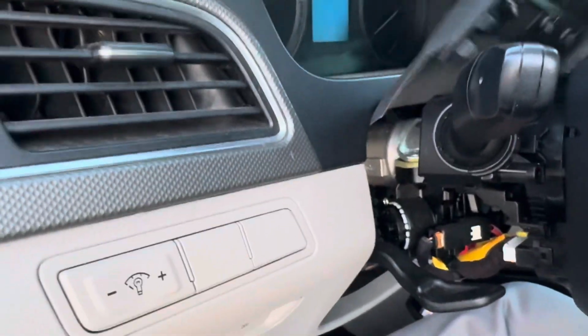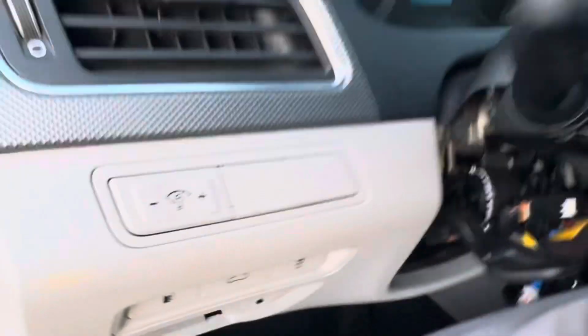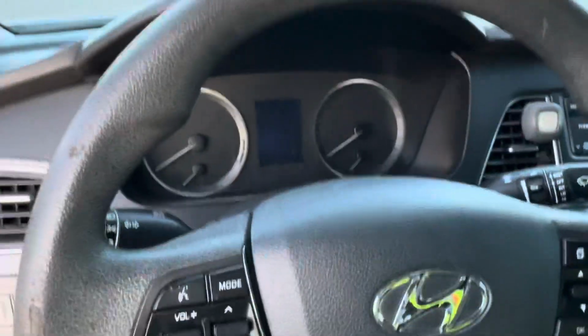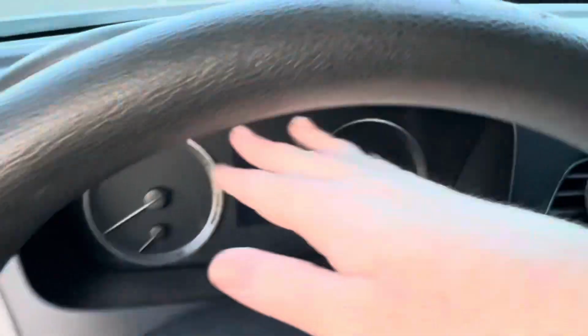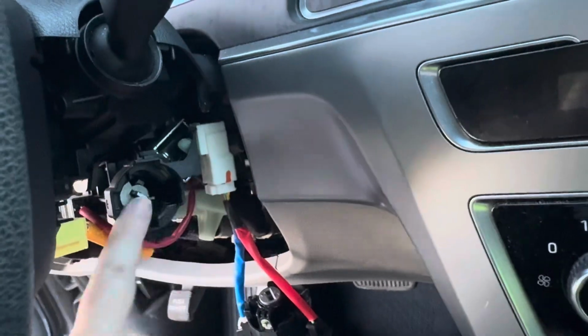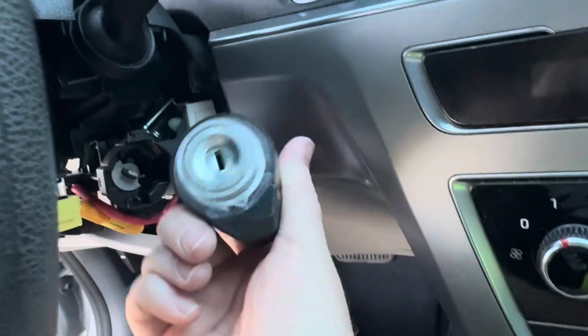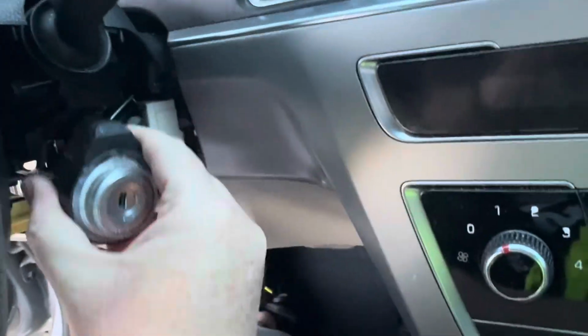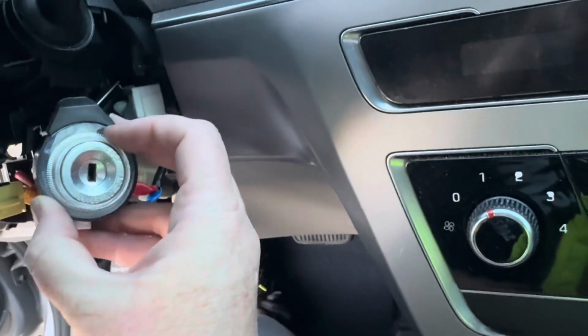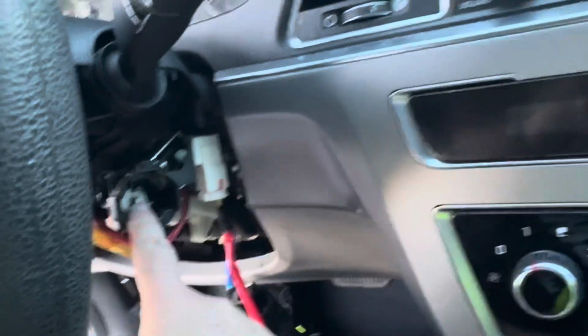Look, insurance companies are just getting rid of people who have had them for years and years and years. And it's literally because of these cars being stolen. All right, it's not hard to fix it. It literally is replacing this piece right here. There's a top piece and a bottom piece that goes down over this over here. And once you replace that with the metal upgrade that has a lock on it, they can't get to this. They can stick a screwdriver in here all they want and pry down, but it won't come out because that metal also comes all the way here to the ring and keeps this locked in. They can't snap this down to get to this.